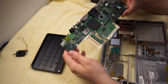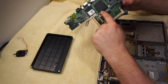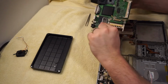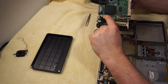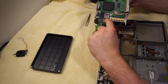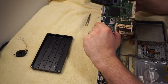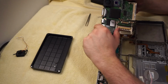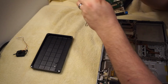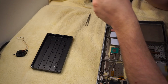It's a nice little compact system. I love how massive the bridge thing is here. So we've got that guy. We have the Radeon Mobility 9000 GPU with 2 16 meg chips, and then on the 1 gigahertz model, these pads are populated with 2 more 16 meg chips for 64 megs total. Of course, there's our G4, our 7450. This one's running at 867 megahertz. It's got a meg of L3 cache. That's that chip there and there. They're 512K. This one might be 512K L3. No, I think this one's a full meg.